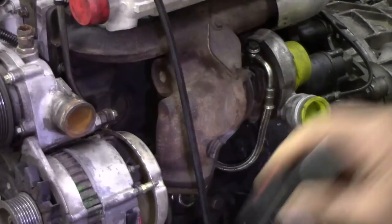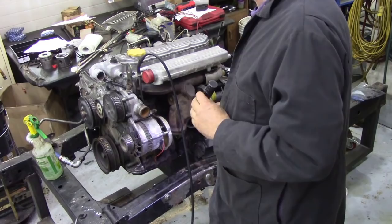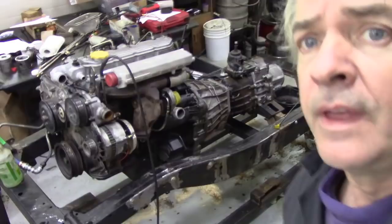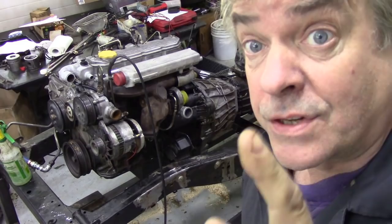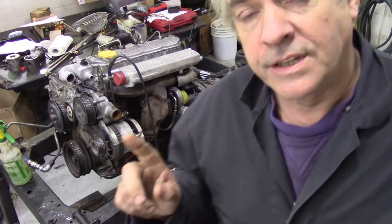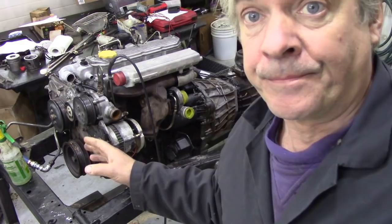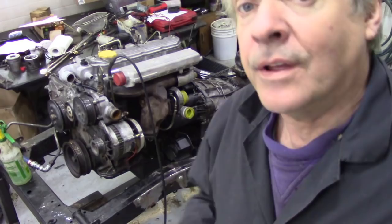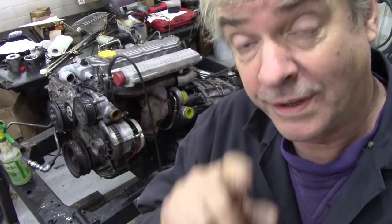It's very hard to pick up but it's not detrimental because there's no oil involved in there. When the manifold warms up it'll nip round that shaft and take up the clearances a bit. The other place it's leaking from is a little bit out of the turbo seal between the turbo and the exhaust. I'm not concerned about that either — the seals in the turbo aren't like a regular oil seal, they're a metal shimmy type, and this has got no oil in it so until it's warm those seals aren't going to work.